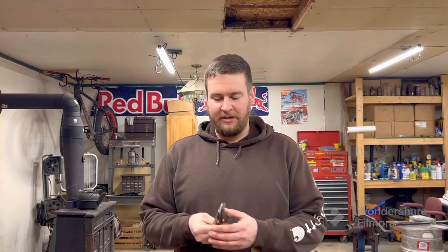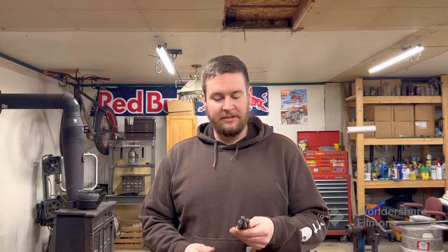But from looking around online, the bolts that hold the subframe into the car are the same thread, and they should be long enough to fit through my engine stand to go into the block of the engine. So what we'll do is I'm actually going to take one of the bolts out of the subframe right now and see if that's correct, because I would rather have 4 bolts holding the engine up instead of just 3. A little extra is pretty good. So let's get after it. We'll take bolts out of the subframe and see if we can use it.